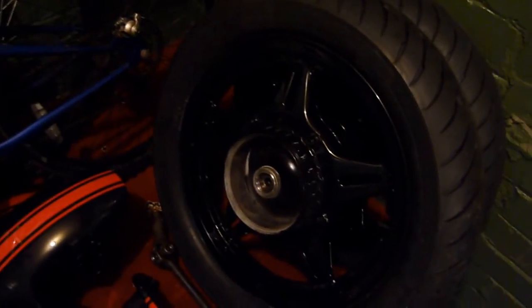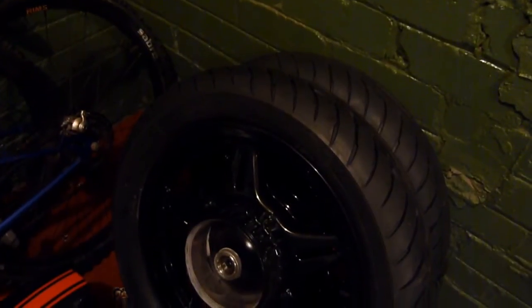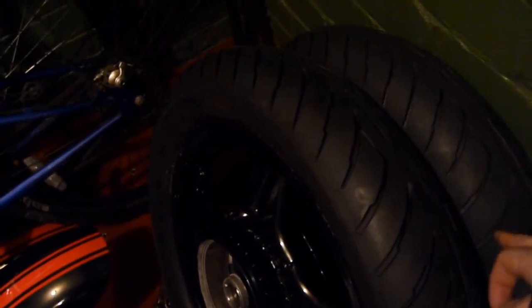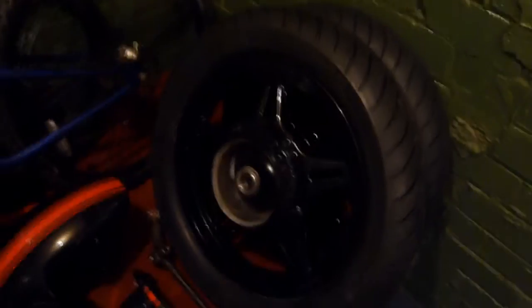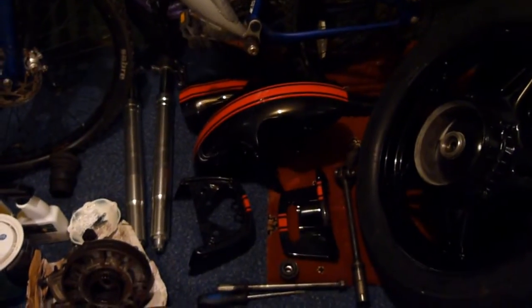As you can see I've got my wheels all done. I still haven't tucked some of the masking tape off so I'll have to do that. I've got rubber on them — I decided to go with a set of Avons, good tire company. The back one has got a 120, that's 10mm wider than the stock one. The reason I did that was the front wheels are 120 as well, so I kind of want them to look the same width. Technically it will be a bit smaller in width because I'm putting it onto a smaller width rim so it bends in a bit, but it looks quite badass. I just hope the clearances on my rear hugger are still alright — fingers crossed they should be.